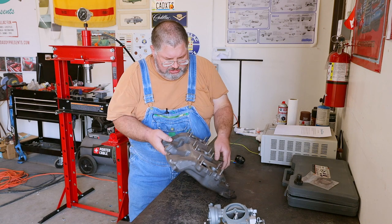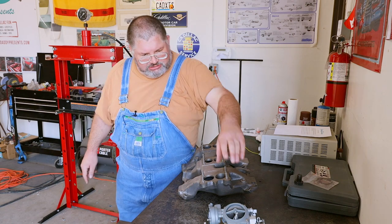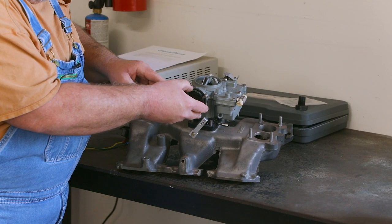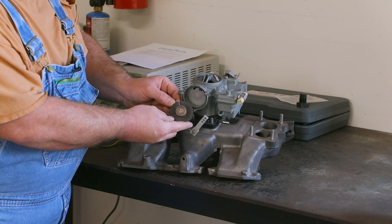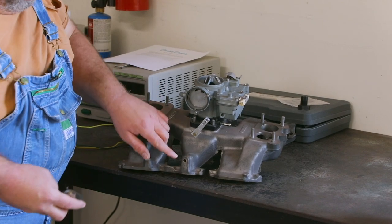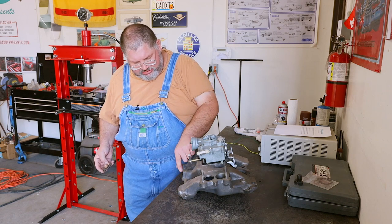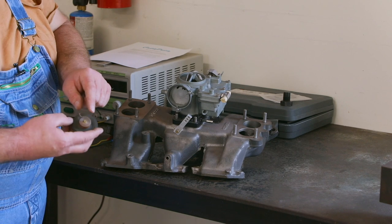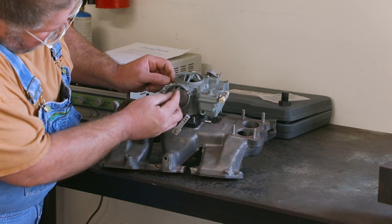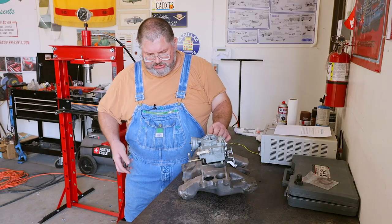So when the engine's running, we'll have exhaust gases coming through this tube. And that tube has another pipe on it that leads to the carburetor. And inside the carburetor is a bimetallic spring. This spring moves like that with temperature. So you have air being sucked through the tube by a slight vacuum leak into the carburetor. So this warmed air is being sucked into here. It warms this heating element, or this thermostatic element, and operates on the lever here, and that's what will slowly open the choke as the engine warms up.